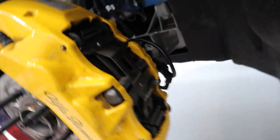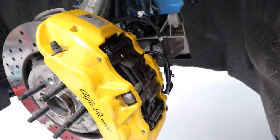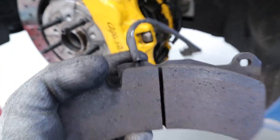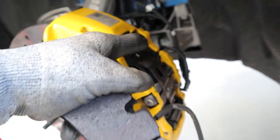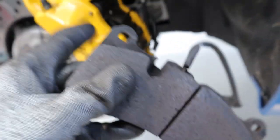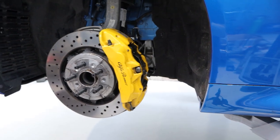Quick note: the reason the brake sensor wire looked weird when I did it before was because I actually had the wrong pad in this side. Turns out the wear sensor is not right in the middle - it's on one side. So the pad with the wear sensor has a specific groove to hold the wire on the upper part of the caliper. If you put the wrong side in, the wire ends up in the wrong place and looks weird. So if you're doing this yourself, make sure you get the right aftermarket pad on the right side. The one without the wear indicator can go either side, but the one with the wear indicator - there is actually a left and a right.